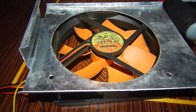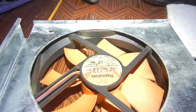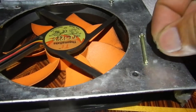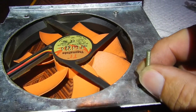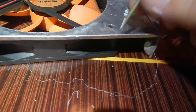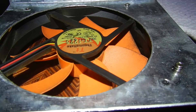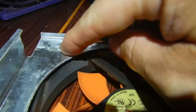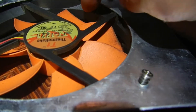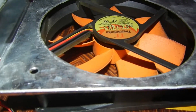Here we go with the fan fitment. If you're doing this with a computer fan as a replacement: what they originally had were long bolts and nuts in the back, which means you have to take the whole thing out to screw it in, and the bolts sit proud of the fan on the inside. What I'm doing instead is using computer screws with a little cover on them and screwing in from the back, so they sit flush with the bracket. They fit through the holes with a little force and bind in nice and tight into the fan case itself - nice, rigid, no risk of rattling.